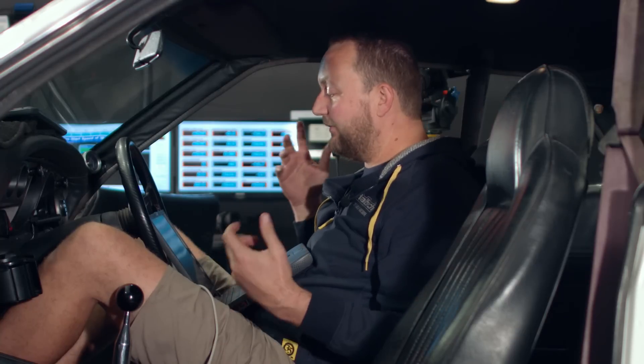At the time, this was pretty cutting edge. Before we start this thing up and try and give it a tune, one of the things I did want to point out was something pretty amazing. Back in 1986, when Haltech first started, they actually held the patents for real-time engine management. What that means is that before then, any tuning change that was made used to have to get applied, then you'd turn the ECU power down, power it back up, and start it again. Current day ECUs, that's just not how it works anymore. What I'm going to show you here is pressing page up and page down and watching those bars move up and down changes the engine in real time — and that's what Haltech held the patents for, which is pretty amazing. That was the first in the entire world to do that. So a real breakthrough technology. Let's start her up and do some F9 tuning.